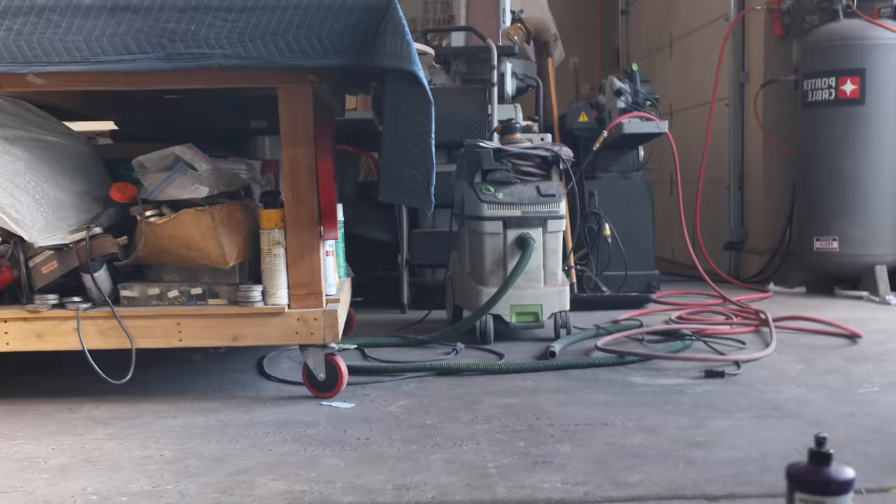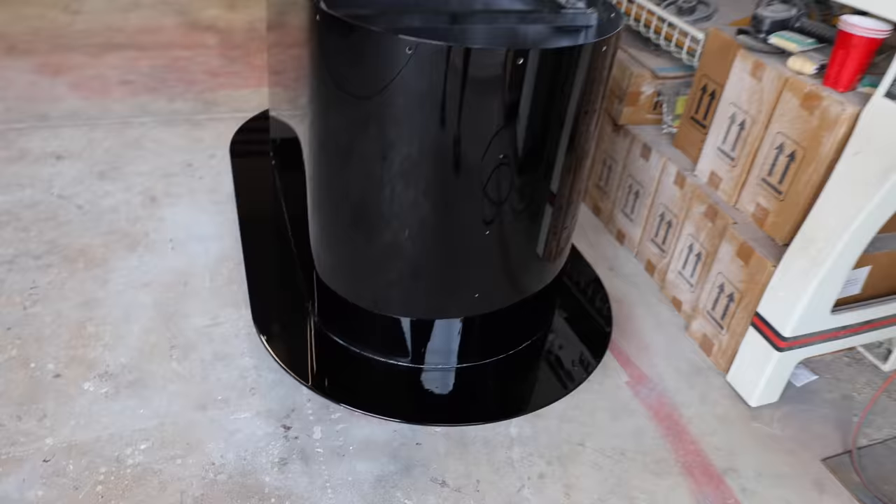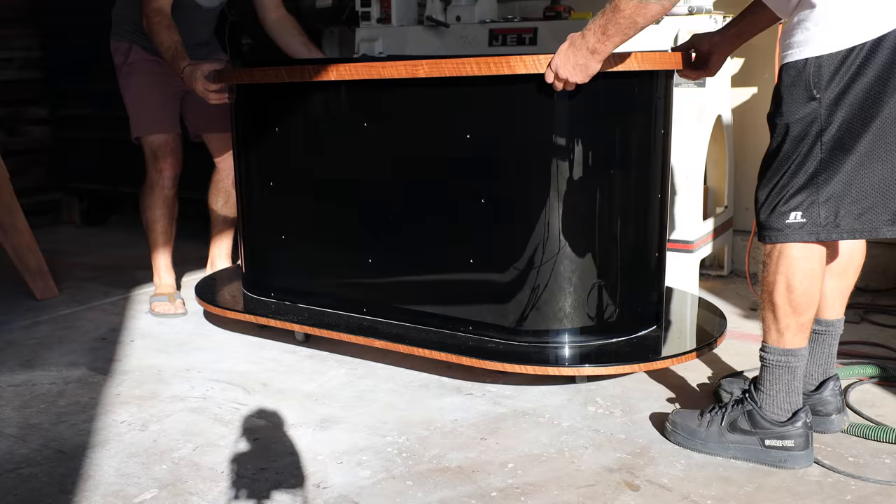I think it came out really good. Like I always say, nothing's perfect but you strive for perfection — settle for excellent. In these automotive finishes, after a couple weeks of cure time I start the polishing process with a stage one and two, let it sit for another week, then redo the stage one and two because I get some dye-back in the finish, which basically means some of the glossiness you achieved will dull out a little bit. I got it pretty good to where I wanted, did a few touch-ups here and there, and now it's time for the rings.